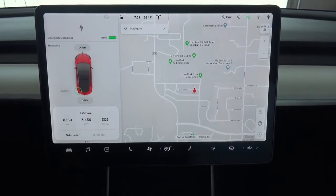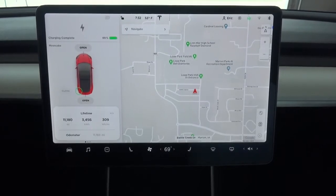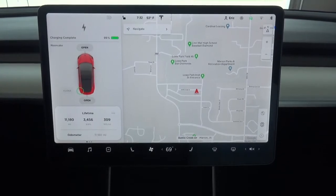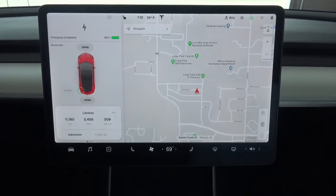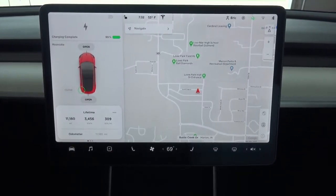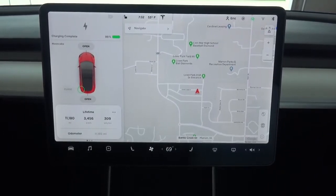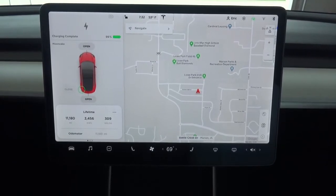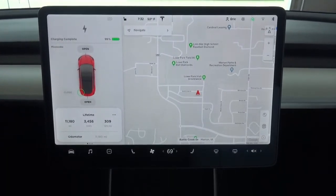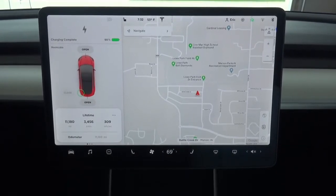In order to get ready for my drive test, since the temperature is 53 degrees, the battery will need a little heating. I'm running the climate preconditioning function from the Tesla remote, which heats the battery up to get it within range. I started 30 minutes before I wanted to drive, and that should get the battery up to temperature so I can get the most accurate range result. Otherwise, a cold battery doesn't have quite the capacity that a warm battery does. Since I'm trying to match what the EPA would do for this test, I've been preconditioning the battery and getting it up to temperature.